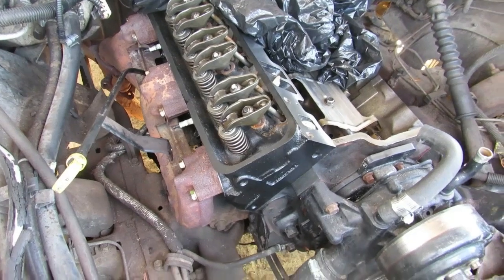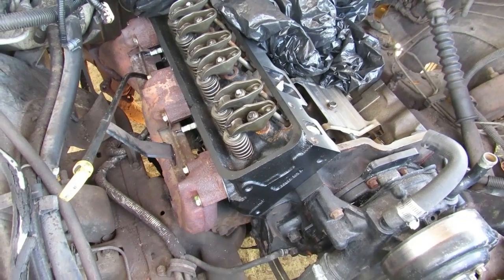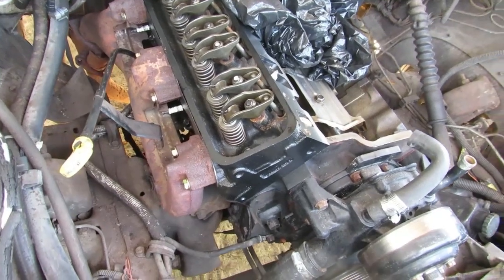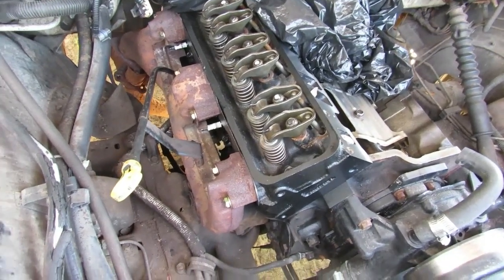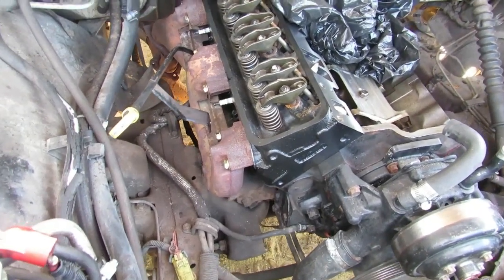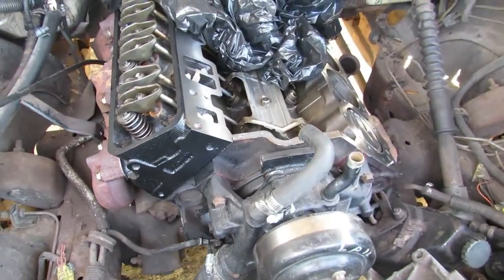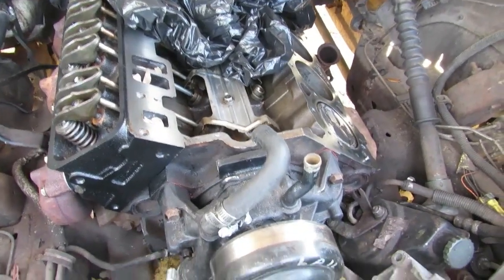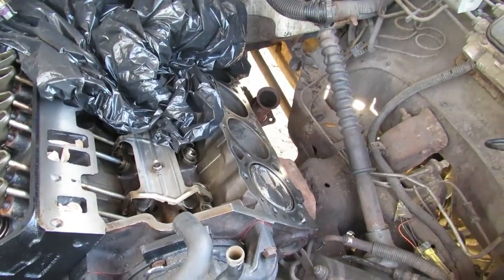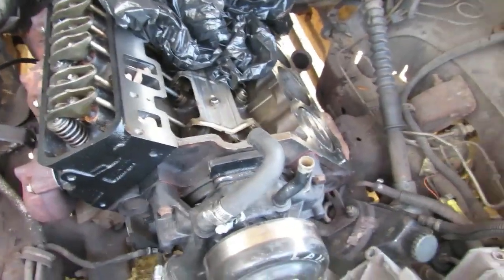The new block check fluid comes in a black bottle - they're real sensitive to light. A kid staying here with my son bought a 2007 Explorer and it's got a blown head gasket, so the new fluid worked on that one. If I have to let it sit for a while I'll just throw it away and buy new. I had a sneaky suspicion it was a head gasket; I was just hoping it was the intake manifold because these intake manifolds are kind of hinky on these Vortecs.